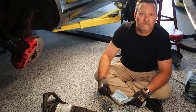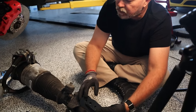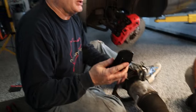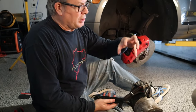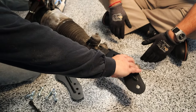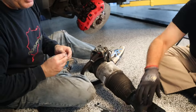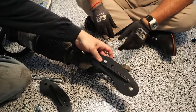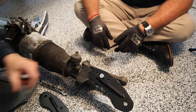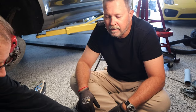Next step is to extend the strut legs. These extensions account for the lift. Because you cannot put a large lift assembly directly on top of the air strut, Eurowise came up with these pieces that fit right on top of the legs and assemble with three bolts on either side. Critical thing: the bolts have to come in through the bottom — if you come in the other way, they could hit the drive shaft. Big bolt in the middle, two smaller bolts on either side.